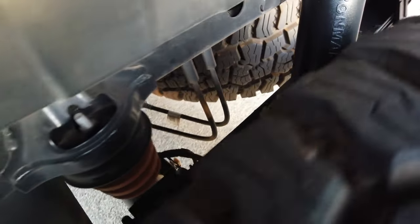Yeah. Suspension is done, so we'll do a quick walk around now and go through what's actually happened to the Ranger. Starting with the rear, we've got the B-Spec Ironman springs. They're 0 to 300 kilo constant load. We've gone with that because we want to achieve a GVM upgrade of about 220 kilos. So that will achieve that, and it'll also be great for towing. So that's why we've gone for the B-Spec springs.